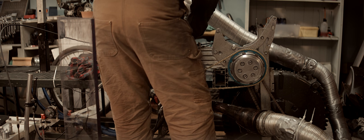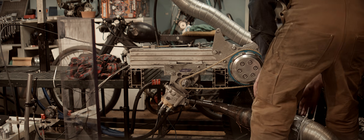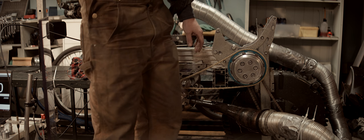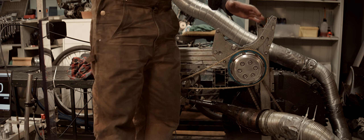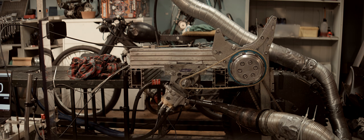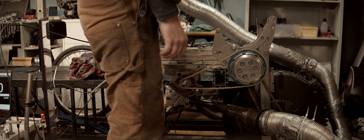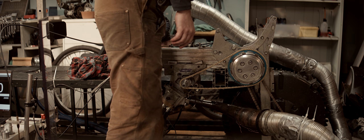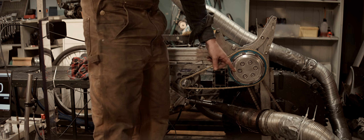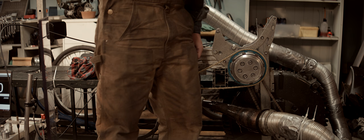Sounds promising. I think there's an exhaust leak here — a little bit of blowback. We do have time for a little test; I can't reheat the garage back up from the temperature it's sitting at now, so this will be it. Let's get a baseline today — fuel on, 17 millimeter stinger for this first test, which is safer than 16. Let's go with that for the initial test.